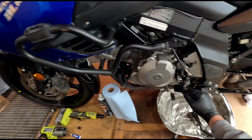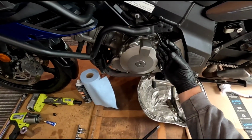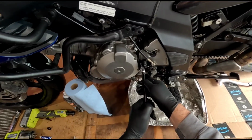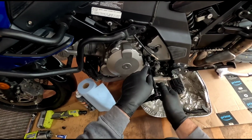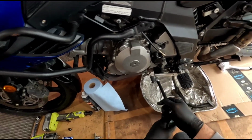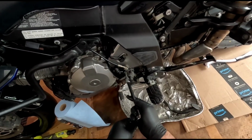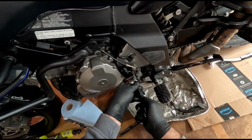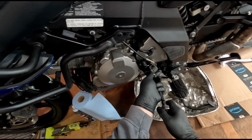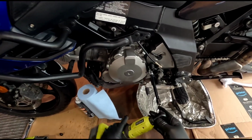Okay. So with this being pushed in, there's pressure pushing against this push rod that goes over, and it's opening the clutch basket. So there's springs on there, so there's like spring tension now against this. That's what I'm thinking. So I wouldn't want to undo one side and then the other, because it's going to want to push on it. So I kind of want to do this evenly, like do a little bit there, do a little bit there, do a little bit there. Yeah, I can see it twisting back and forth. A little bit there. Yeah, there's pressure on it. But that's what the book says to do, so maybe there's something about it that I'm not seeing. There, so it's loose now. Oops. And then we'll just spin these out real quick.